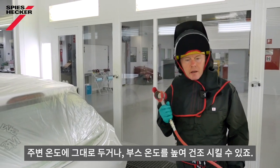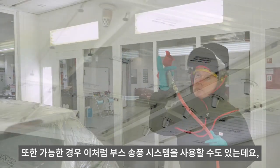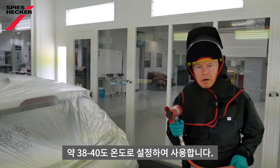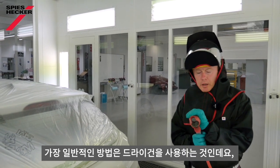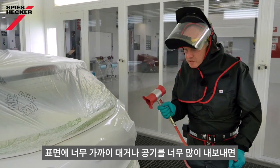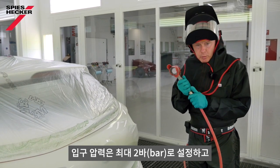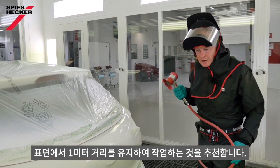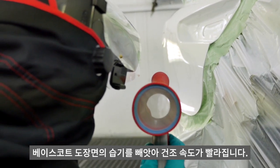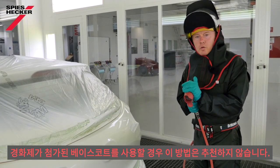For drying the base coat, I have some options. I can either leave it at ambient temperature and let it do its own thing, I can increase the spray temperature within the cabin, or if available, like here, I have an in-booth blowing system. These are normally set at a pre-designated volume of air and a temperature of around 38 to 40 degrees C. Most common in the market, though, are hand-held venturis, and this is where sometimes people can go wrong, inasmuch as they come too close to the surface and put too much air, and can then induce pinholes in the surface. Our recommendation is a maximum of two bar inlet pressure, one metre distance from the object, and I like to use it at an angle which allows the air to flow across the panel, creating some gentle turbulence to draw the moisture out of the base coat and speed up the drying. Remember, though, this is not recommended if you are using activated base coat.